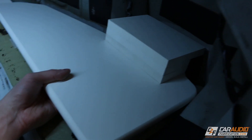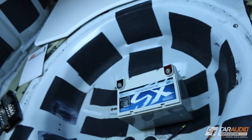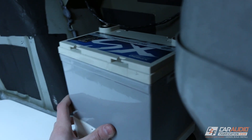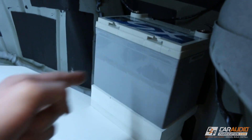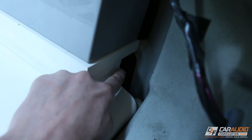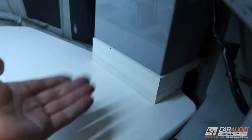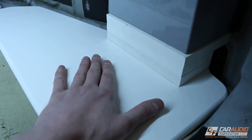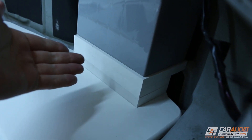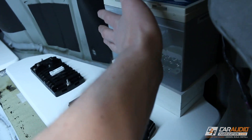Let's see how this fits. I built a riser for the battery, and the reason I did that is it gave me about another inch of additional clearance so I was able to move the battery back in this direction — I had to do that to get over this vent back here. You'll also notice that from the other side I ended up using mechanical fasteners. That just gives us two layers of protection to make sure that this is good and solid. The CA glue is extremely strong, but it doesn't hurt to also have those mechanical fasteners.